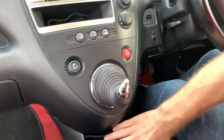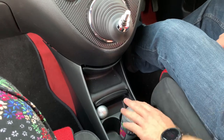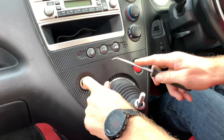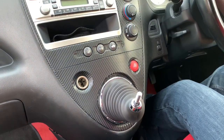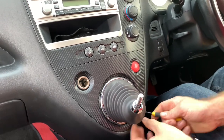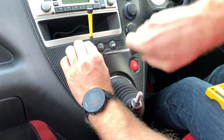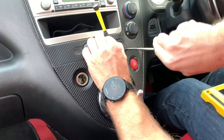These cars come with amazing storage pockets all over the place down here - you can tuck anything in you want. Once you've removed your gear knob you need to take this lower part of the panel off. I found one of these trim tools but it's still too large, so we'll try the small pack of screwdrivers. I really am going to order a proper trim removal tool off eBay tonight. I'm not too bothered about marking this one because the carbon wrap on it is pretty shocking anyway.